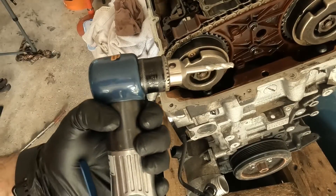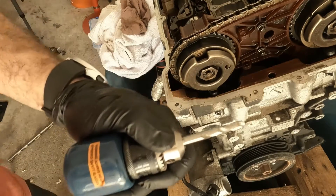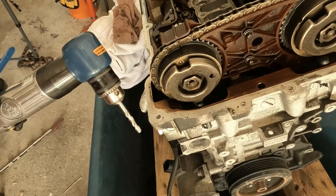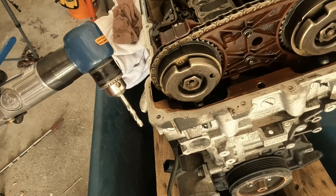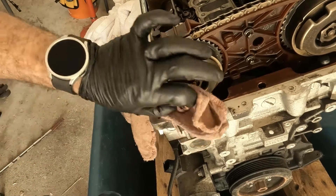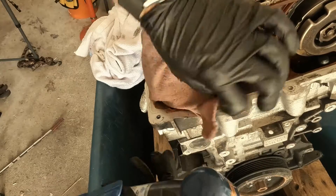Because of the wobble situation, I actually prefer to use a more traditional air 90-degree angle drill. Snug down the bit and we'll do our wobble test — nice and straight. So this whole process is quite satisfying because you get to drill out some metal, re-tap the threads, and fix everything. Remember, the first thing you're going to want to do is lubricate everything. Cover your area if you're working somewhere where you can get metal filings into places you don't want.